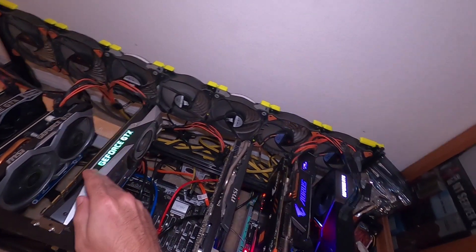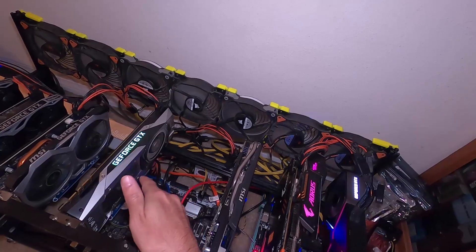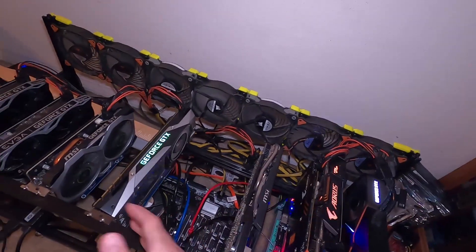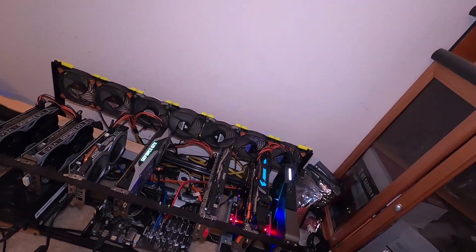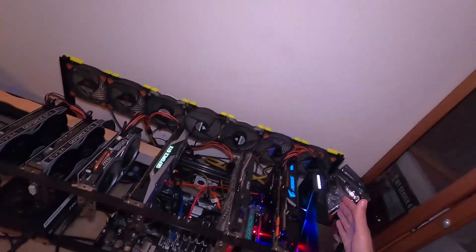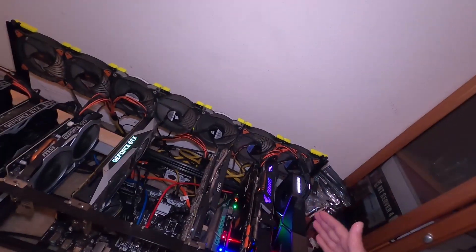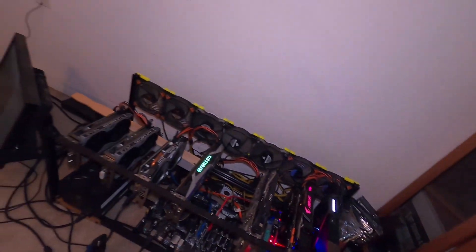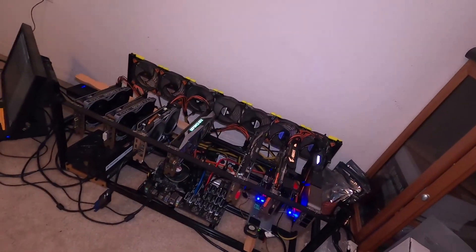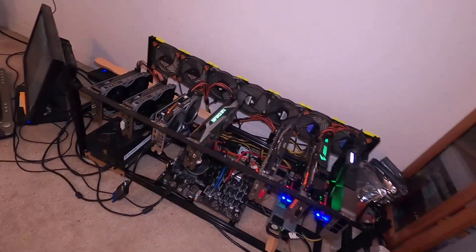It's not as big of a concern with the 1070 blower style cooler, because those cards notoriously get hot just by themselves due to the cooler design. Open air won't be impacted as much by the 3080, but it's still an impact. I hope you guys take the data from this video and use it to make an educated decision when building your rigs — especially if you're going to run a bunch of 3080s, 3090s, or whatever with this new FE design. It will impact the thermals of the cards on your mining rig, so keep that in mind. Hit the like button, subscribe for more content, and let me know in the comments — do you have a 3080 and how's it mining for you?